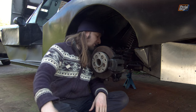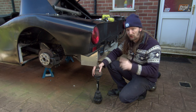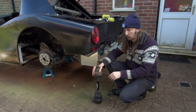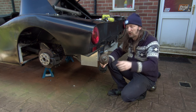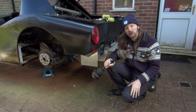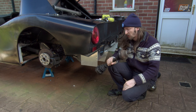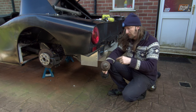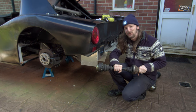To solve the ARB problem we need the car on the ground with the alignment fixed, and to put it on the ground we need to load up the bearings. To stop the bearings from egging under compression we're going to pop the driveshafts in. This driveshaft is in perfectly good condition but unfortunately totally useless for us because of our aforementioned widened track. We'll pop it in anyway, which gives us a chance to get the wheel back on and get it on the floor - and also to demonstrate just how screwed we are by having widened it.